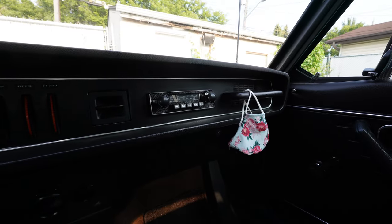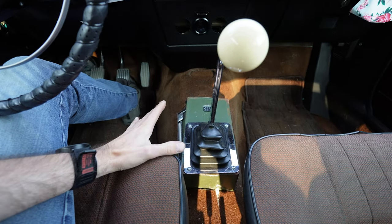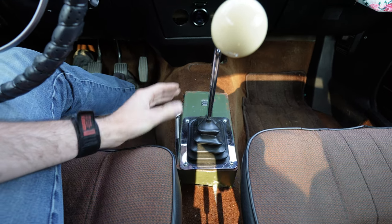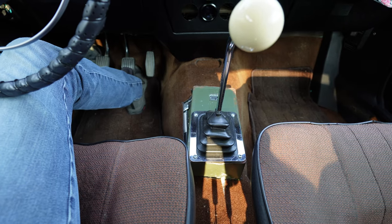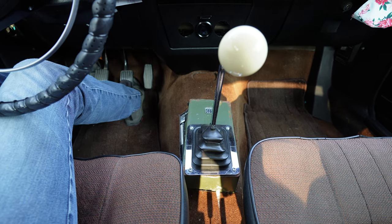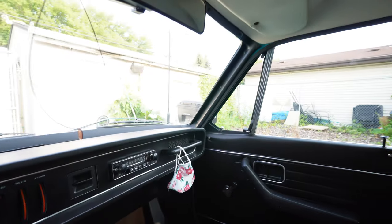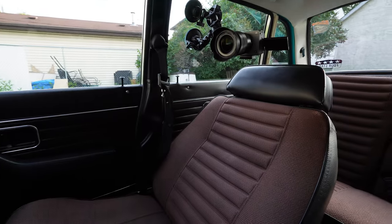The rest of the car is what it is. That radio does not work, but I don't care — I don't really use a radio. To get the B230 to work, we ended up slightly modifying the tunnel with an ammo can and a big old shifter. And you know what this is attached to — this is attached to a T5 out of a turbo Thunderbird. That is mated to the engine through an adapter plate that Yoshi Fab produces.